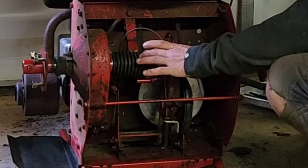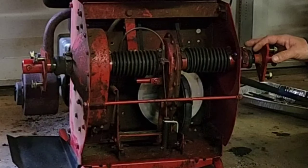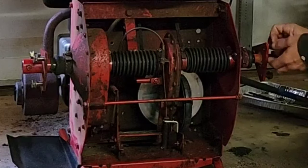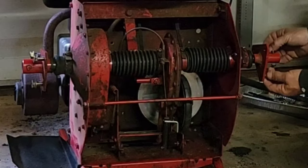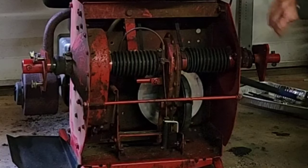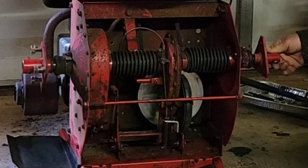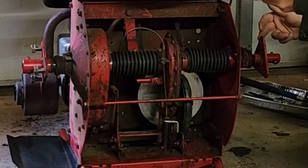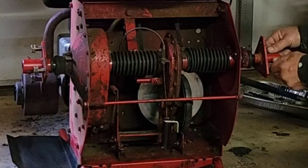So, to do these boots, you have to take this wheel off, and this would be the driver's side wheel. And so to take just the wheel off itself, you have these three bolts, okay, which we're getting ready to put the wheels back on. Now, if you didn't need to change the tires, instead you could remove the entire hub with the wheel on it. And to do that, there is this bolt right here with a nut.